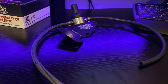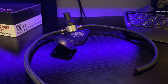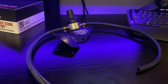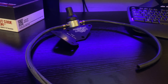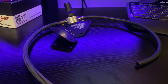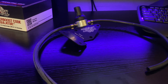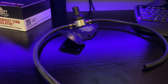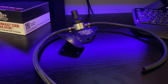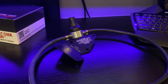So for the 7.3s, you do want to have this for optimal performance and maintaining your proper air-to-fuel ratios on your lower boost levels. If you try to bypass this over-boost code — which you're going to see as a check engine light — with a tuner, you can get it done, but you're going to have performance issues and you're not going to be running at optimal efficiency, due to the fact that you're messing with your lower boost end tables. So refer to KC Turbo's videos on this; they're the experts really on this matter. They clear this up pretty well, and my recommendation is to go with a mechanical one.